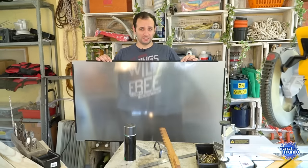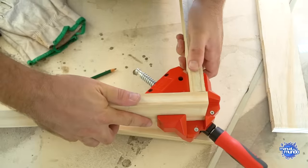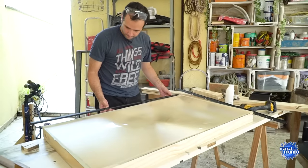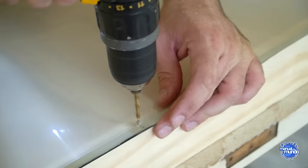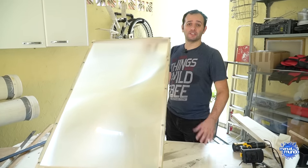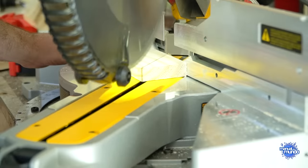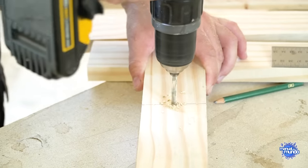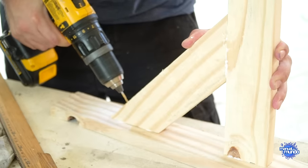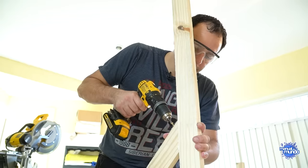First of all, I'm going to make a kind of frame similar to the one already on the television, only much more reinforced — similar to a picture frame. To attach the lens on top of this rectangle, I'm going to make some holes in the plastic and put a screw with a washer. Now it's clean and robust, and I need to make a lateral support for it to stand on its own. We found the ideal height is around 1 meter 80 centimeters, and I'll cut the legs 1 meter high. As I have this super saw, I'm going to make a neat foot to practice some woodworking skills.